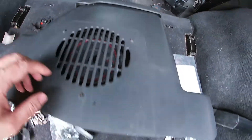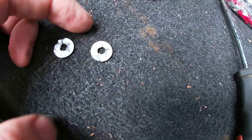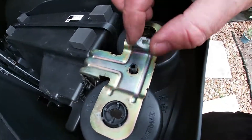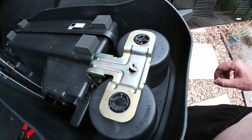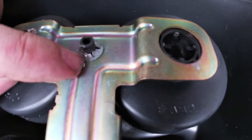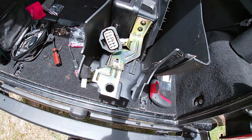Got our sub mounted, top screws in, side screws in. Now we've got these little push nuts — or quick nuts — and we've flattened them back out. We'll try and push these back on even though they're cracked and get them to stick. Got our push nut back on there and they are actually holding. Just push them back down, flatten them with a flathead screwdriver and they'll bend back out and crimp that little tab again — no need to find a replacement part.